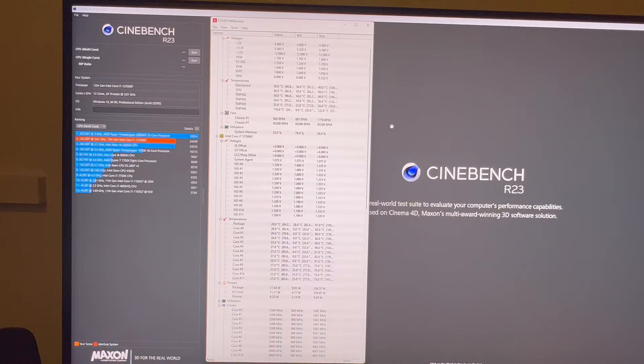I still have a lot more room on my RAM. I'm only at 4,800 megahertz on the RAM — it's good for 5,600, and the motherboard is capable of handling up to 6,200. So hopefully there's not diminishing returns as I go above 4,800. But I can't just enable XMP and have it bring it to 5,600 because that actually slows the computer down by doing that.